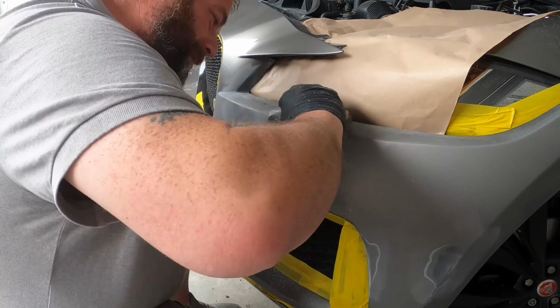Torch out now. All right, let's get some clear coat on this thing. I'm using my water-based clear today. It's got quite a flat finish on this. My Devilbiss is more of a factory peel. I can get it to lay flat, but I know I can get it flatter with this. We're going to crack on with a big gun today.